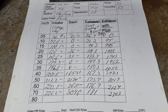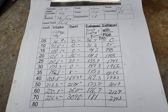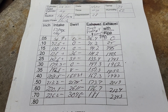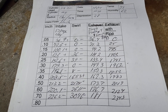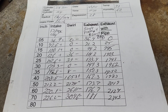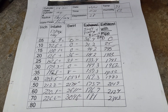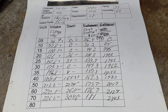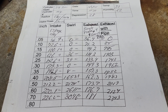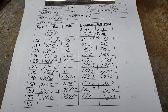As far as not using the original crank and rods out of that engine — I have no doubt, completely stock, they would spin 8,000 RPM and be completely reliable. My buddy Tony Persico told me: 'Charlie, stop wasting your time grinding those rods — a stock Chevy 350 rod is good for 8,800 RPM and hundreds of passes.' He would know. Old Reliable was literally a junkyard engine, and when it would blow up he'd grab another rod and piston out of a five-gallon bucket, put it back in, and make more runs. He wasn't even using forged pistons — he was using cast. That's the very basis of broke-guy horsepower.